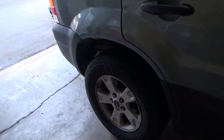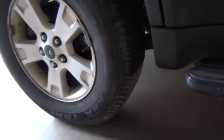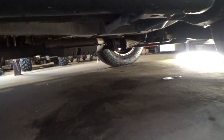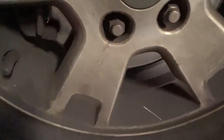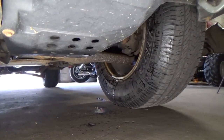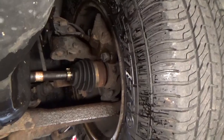A lot of times it could be a caliper, a brake hose, or a brake line that rusted out. Sometimes you can just look at the rims and you may see a little brake fluid on the rim itself. I pumped the brake a couple of times and on that left front I'm seeing signs of something wet, so we're going to focus our attention over there. Sure enough, we have signs of brake fluid around that left front — the caliper is a little wet.